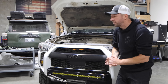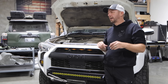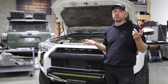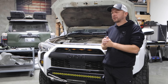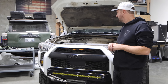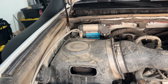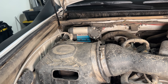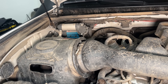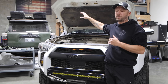I'm a big fan of not using a snorkel on the highway because snorkels aren't always happy at highway speeds. I prefer to get air from under the hood on the highway. AFE has the option to open it up and pull air from under the hood, and only when I'm off-road I cap the cold air intake and get all my air from the snorkel up top, which has cleaner air. I also tried a cyclone on the snorkel but found it doesn't do much for the trails I'm on — it really only handles heavy particles.